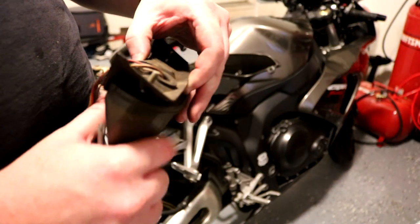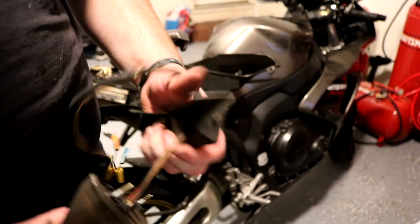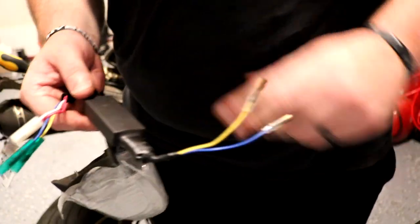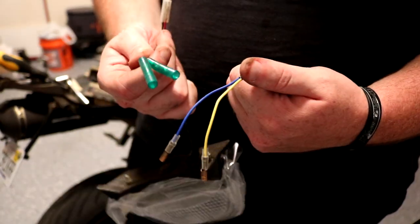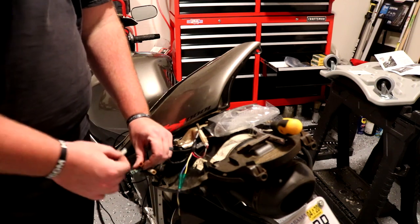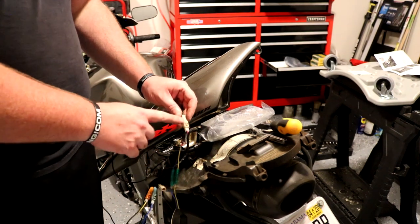What you're going to want to do is extract these things because you're going to need them, and you're also going to need this plastic piece right here. Go ahead and fish all the wires through here. Before you do any of your wiring, you're going to want to take these wires and get them through this grommet. It's got all the sequential programming inside of it — it's really easy to hook up. You just yellow to yellow, blue to blue. Very simple stuff. Connect the yellow and black wire to the orange connector, and the blue and black wire to the blue connector. Then connect the big white connector to the other big white connector, and you're good to go.